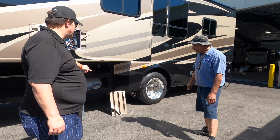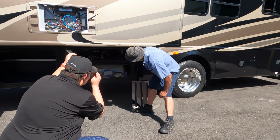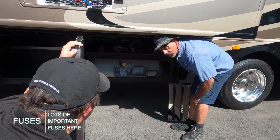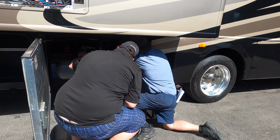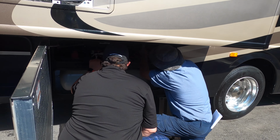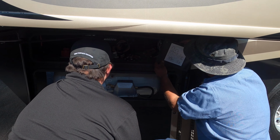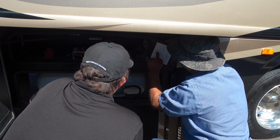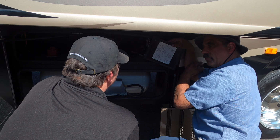Typically. Yeah. So anyway, going back in here, this is a basic RV fuse panel. There's a couple of disconnects in here. Okay. The buttons, I'll show you the buttons when we get inside. But behind this, actually there's a schematic. But you have some fuses. These are your disconnect relays that are mounted in there. This is that isolator that charges your batteries off your engine.